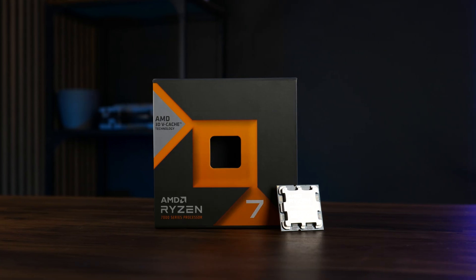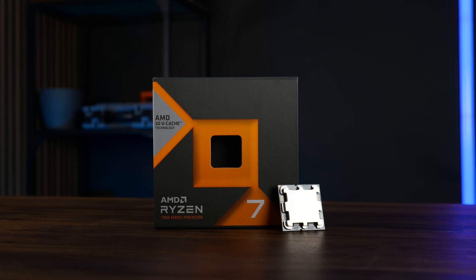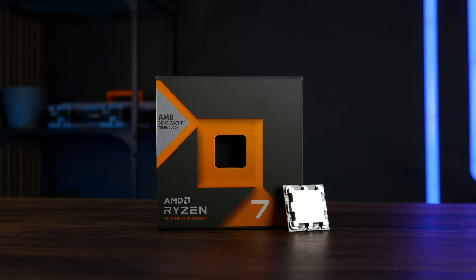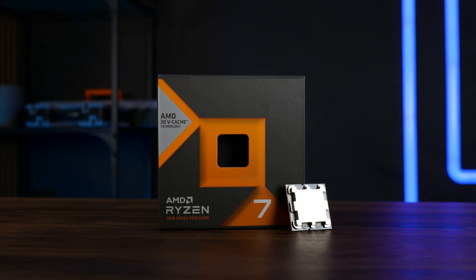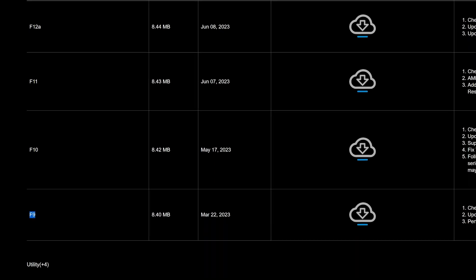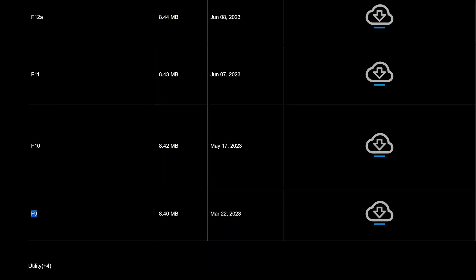After a few days of trial and error, I decided to give the 7950X3D a short break and switch to the 7800X3D. However, it was tanked to the exact same 4.7GHz on all of its cores, even on a single-core workload. So I knew something was completely off and suspected that maybe the BIOS update we had done beforehand had something to do with it. And yes — after reverting to the oldest BIOS available on Gigabyte's website, the 7800X3D boosted to exactly what we expected.